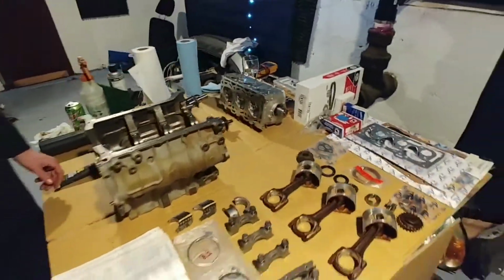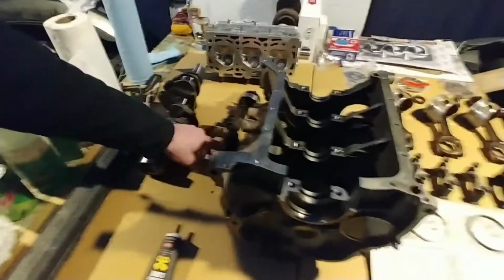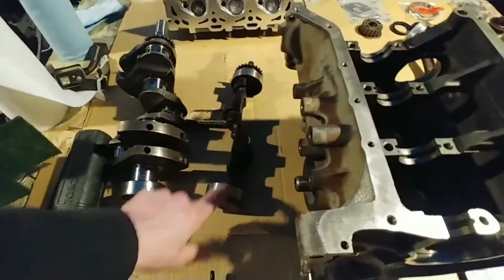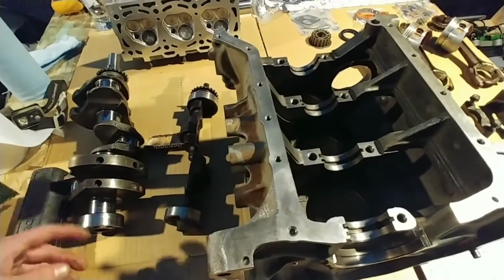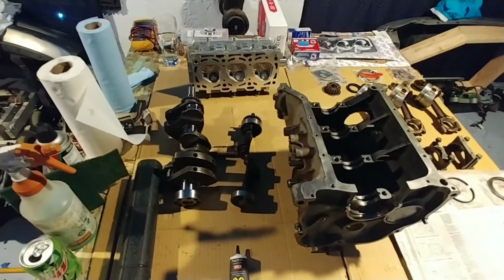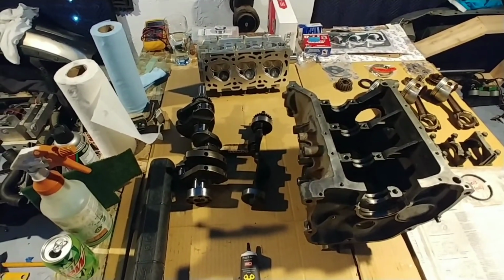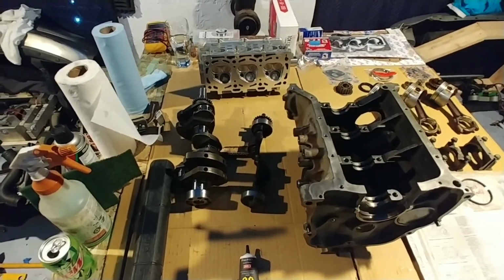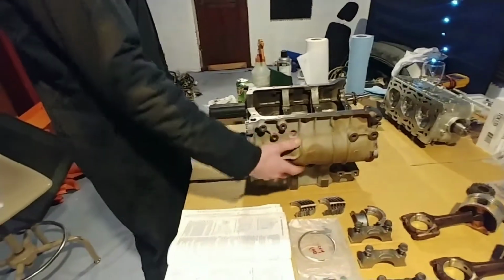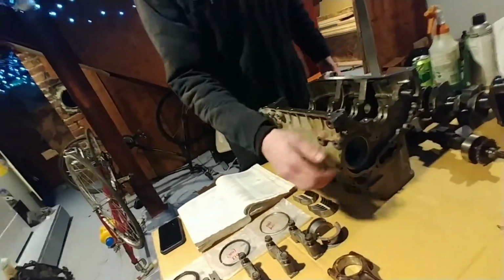Okay, let's run through it. Yeah, it does some weird stuff. The balance shaft here just spins the opposite direction of the crankshaft and balances out all the missing. So it's like a dual overhead camshaft, but there's one that doesn't open any valves at all. It just literally sits in the motor and rotates to keep it balanced. Yeah, it's bizarre, but that's how it works. That's what this big extra bulge is on the block here. Oh, that is really crazy. Yeah, it's just a giant thing that sort of slides in.